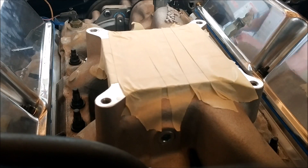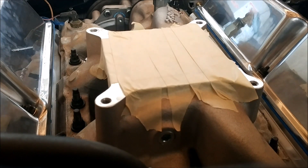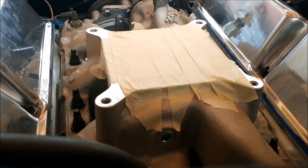I've got my drill hooked up here — I wish it was cordless but it's not. It's always good to get a little lubrication, especially with aluminum, because aluminum is a drier metal and can splinter, crack, and seize up. So let's put a little WD-40 down the drill bit before we go in.